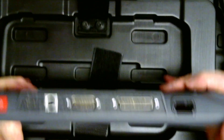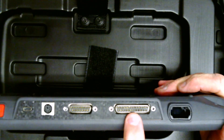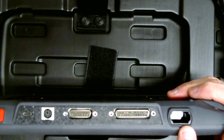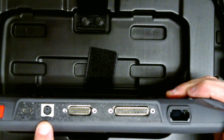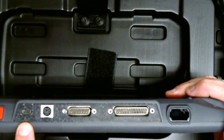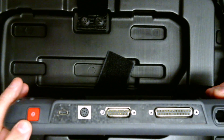On the top, we've got a few connectors. Looks like DB25 — I'm going to assume that's for the OBD cable. There's an IR port, likely for Mercedes keys. Then we have DB15, which I'd guess is for EEPROM reading and writing. There also looks like a DIN connector, probably for remote unlocking and universal remote key creation. And then we have USB-C, which I'd assume is for charging and connecting to a PC. Over here we've got the power button.